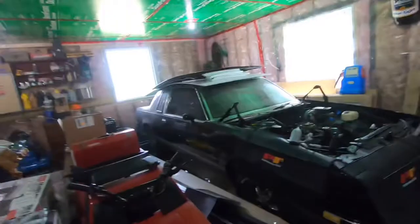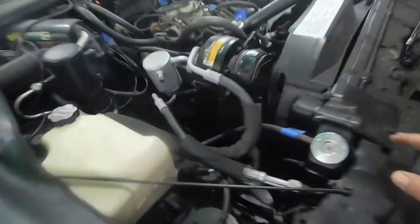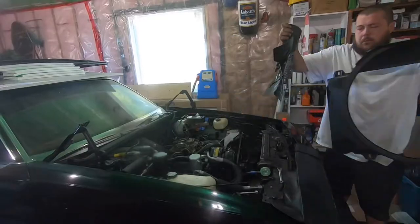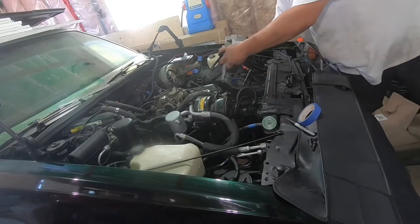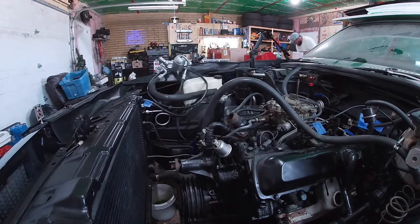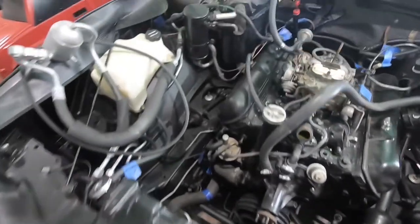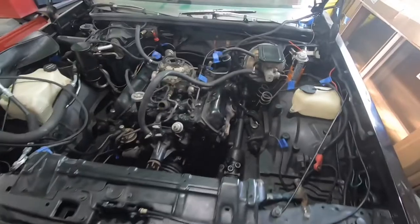I started digging into the old 307 here, grabbing the goodies we need off her. Got the radiator draining right there in place - minimal mess. Got that big tub under there and a little bucket to catch the other jets. There's me walking away with the juice pump, and I grabbed the old power steering unit out of it. Then I had to take the AC compressor out. I labeled all these wires with blue tape, labeled up the hoses - no confusion, put her back together nice and quick.